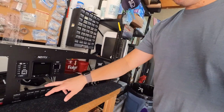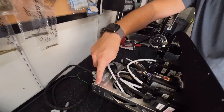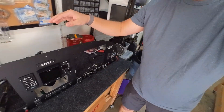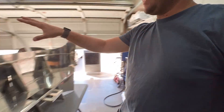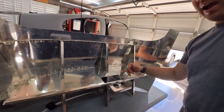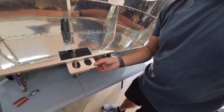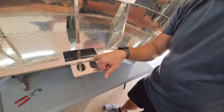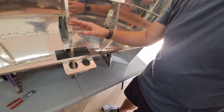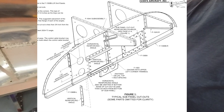This cutout here is for the GPS navigator, the IFD 410, which lives here. You'll notice the cage on the back side — it travels quite a ways away and does interfere with the sub-panel. So basically I just held this over the top, roughly drew some lines around the sides where I thought I would have to cut, and then I've been enlarging it slightly from there. You'll see it is going to start interfering with this bottom part here. I'll be removing this and adding a doubler, basically following the plans — I think it's section 41.